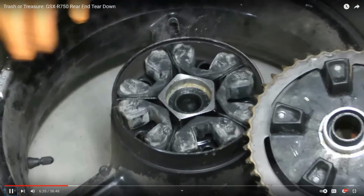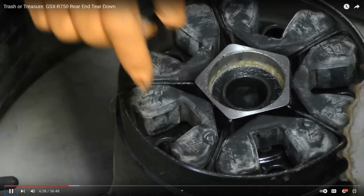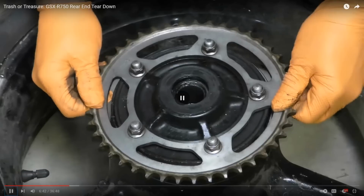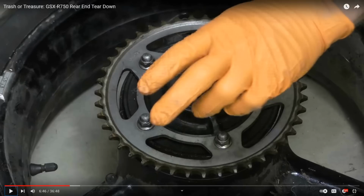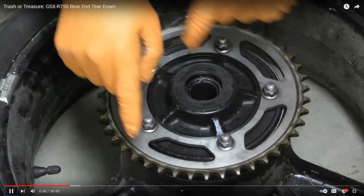Next piece to look at are these rubber drums. Oh, he said if it was missing, you just clamp your wheel solid. And how loose the cush drive is in it. Your sprocket doesn't do that. It's wobbling everywhere. So when we put this in gear... We went through this in the live stream, but turn it, it turns. It doesn't wobble. It's going to smash forward.